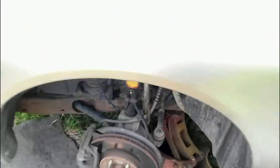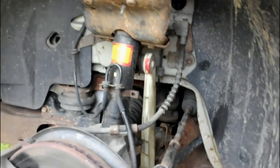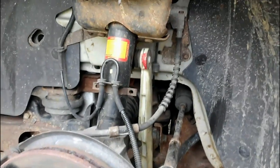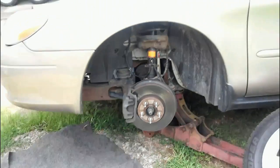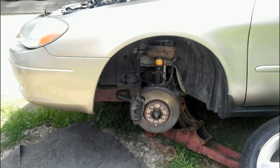I'm very happy about that — I know what my problem was. So now all I've got to do is order new sway bar end links. A little update: if you have any noises, definitely check that. I had no idea that these would be plastic, but apparently they don't break — they just kind of wear out and leave you with all kinds of rattling noise. So that's the end of the video, guys. Good luck — definitely check those sway bar end links.